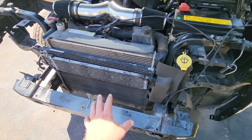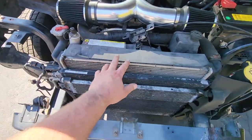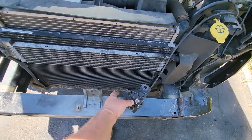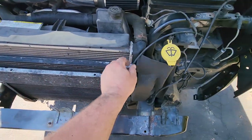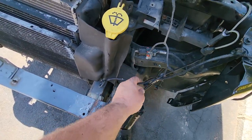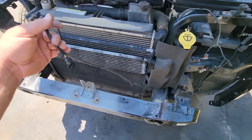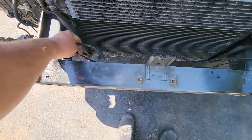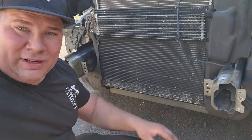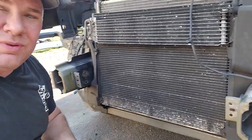Funny how this always happens when I work on a Jeep. We took off that radiator support bracket — just four easy 10 millimeter screws. Then this piece, the hood latch, also comes off — that's two 13 millimeter screws. This comes down with those two little bars that come across, and there's a little tab that holds on the washer fluid container to that bracket. Then you have this little mess right here — this is the ambient air temperature sensor, it lays inside this little housing. After a lot of fighting and struggling we were able to take off the front bumper and cut the spot welds off this frame piece.